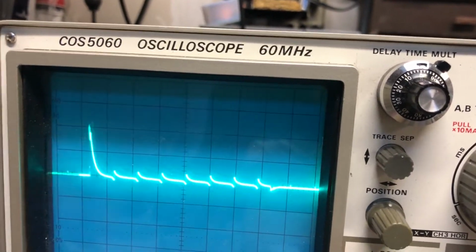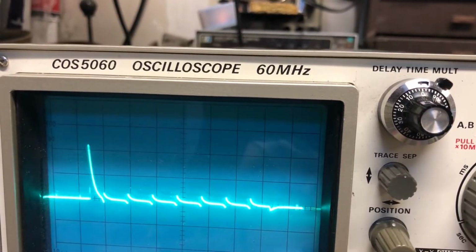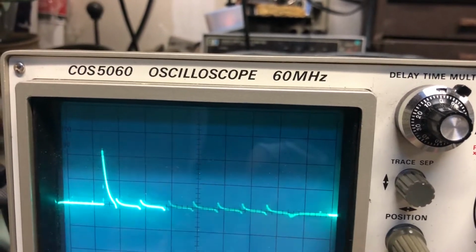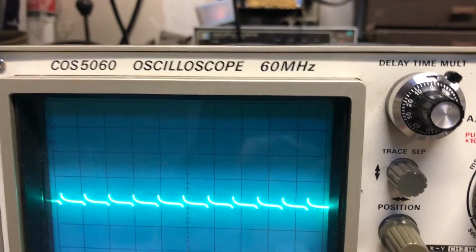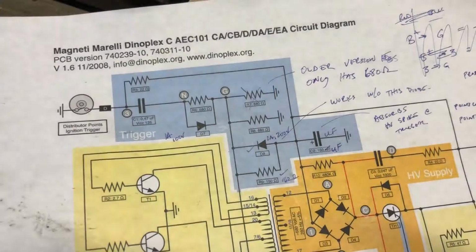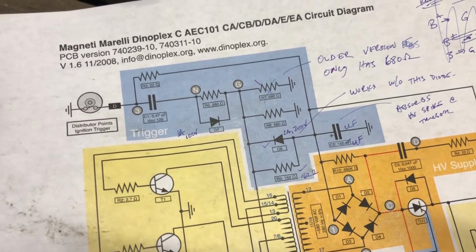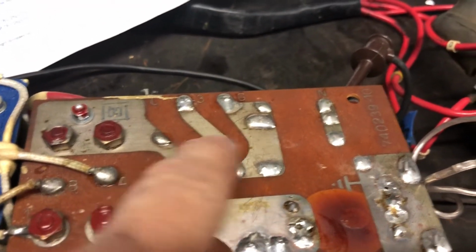Anyway, somehow I think that resistor is collapsing, and the inductance in the resistor is what causes the voltage boost as the current from the capacitor runs through it and resists that change. Okay. All right, now I'm across 3 and N, which is just the capacitor. And so I move this probe to 3, reference still at N, same setup.